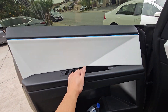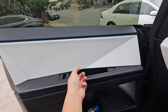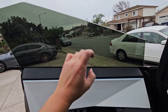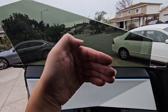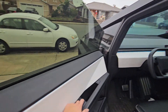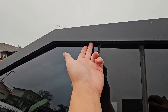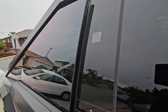The reason you don't want to use this as a daily door-opening thing is because if there's no power, or if you do it fast, the window won't roll down enough before the door comes out, and it can result in pulling out the trim. Because normally if I roll the window up, you can see the window goes underneath here. So if there's no power and you just open it, it's basically going to make the window come out and push on that. So that's how you do the driver and passenger door.